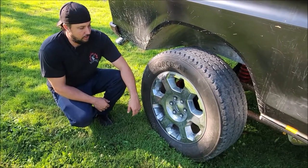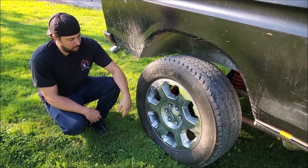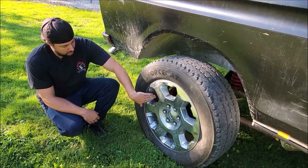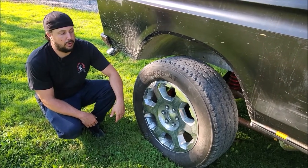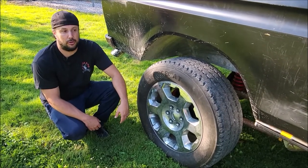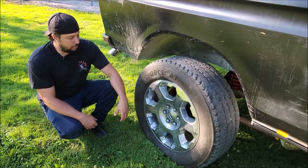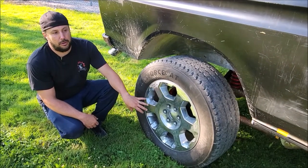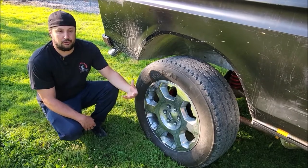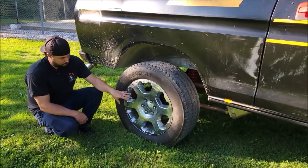On the rear, we had to change the rotor face, change the axle face diameter, make a custom mounting plate for the brake, and make sure our emergency brake is still functional. Because when you're towing down to the water, you want to make sure that extra brake is there to put the boat in the water. It's details like this that may or may not be seen when we head out to SEMA.